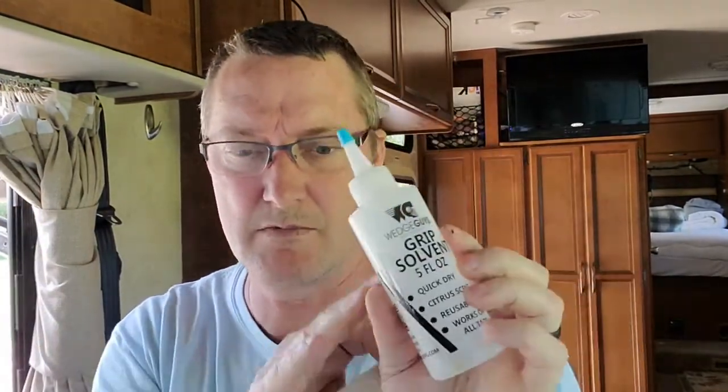And then normally on a golf club, you would slide the rubber golf handle down, position it the way you want, it's still slimy for a while. This solvent will then dissipate. It'll dissipate out, it's kind of like alcohol. It does not have an alcohol smell, it smells like citrus. The solvent will dissipate, and the sticky tape will go back to sticky.